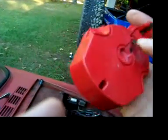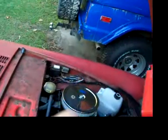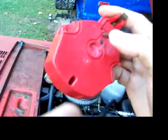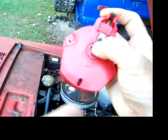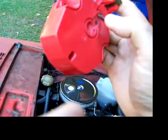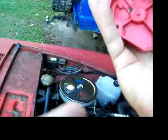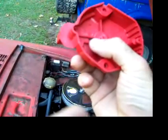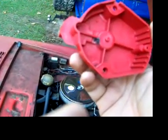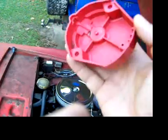And if you look really closely, there is a pinhole where, just like a lightning bolt, it managed to find it. You know, if you've got 2 powerful magnets and a piece of plastic in between them, the magnets are still going to attract through the plastic. And in my opinion, what happened here was I had so much spark right here at this point that it just looked for a quicker place to get to its destination, just looking for a ground. And once it grounded to the mechanical advance assembly, that's when the distributor stopped functioning and left me stranded, just stopped running while I was driving it.